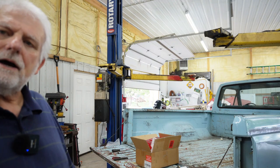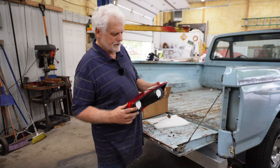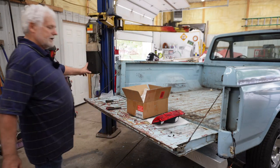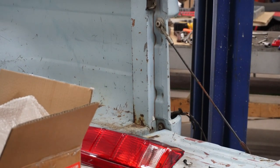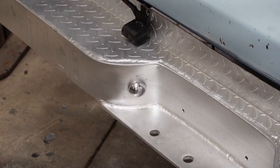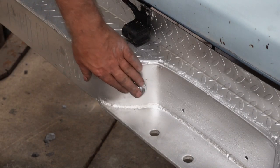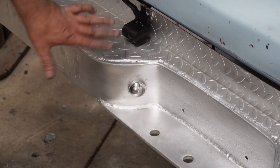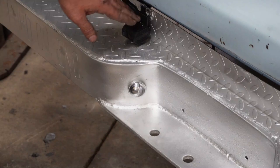The bed's bolted down and I'm working on the lights now. I went ahead and bought new lenses and they look pretty nice. I've got one installed — there's the new lens; turned out pretty good. At least you can see the lights now, where before I couldn't. I also had to attach my backup camera and rewire the license plate light completely underneath — it was all shorted out. This hasn't worked for a while due to a blown fuse under the dash. I hope to get that going again.